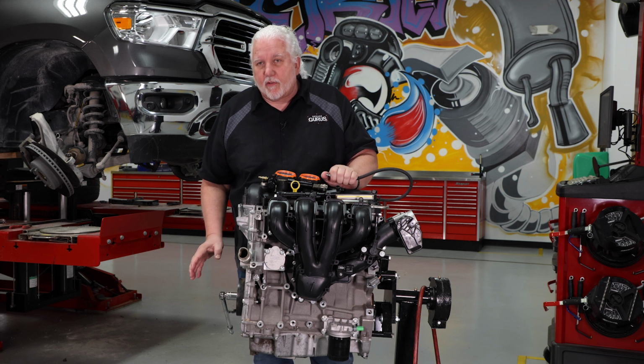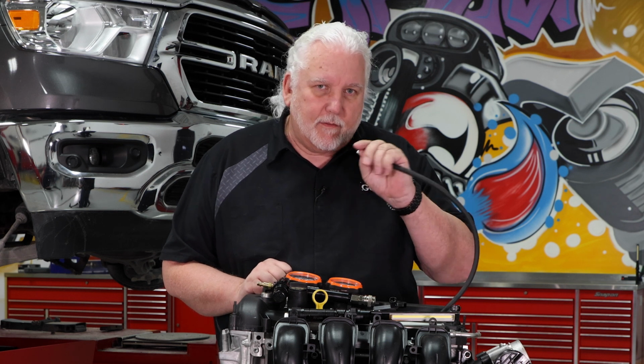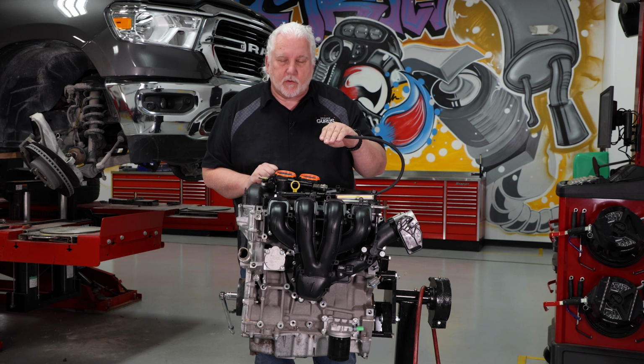The second part of this is you may need an assistant to actually hold the crankshaft, because if you're not perfectly at top dead center, the piston will want to turn. The air pressure we're going to put in there is substantial enough that it would push the piston down. If you do happen to get it perfectly at top dead center, when you put air in there the crank won't turn, and I've been able to do that.